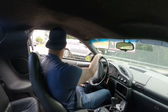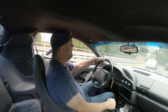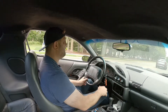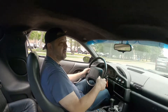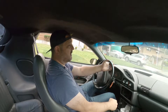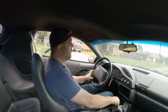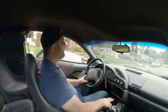This car is really fun to drive now, and I'm kind of thinking I don't know if I want to go with stiffer springs and shocks. I'm not sure yet, because the car is fun and it's streetable. I'm looking at the Strano setup right now — from what I understand it's like a 550-pound rate in the front and 250 pounds in the back. I would like to have the car lowered a little bit, but I don't know if I want to sacrifice ride quality.